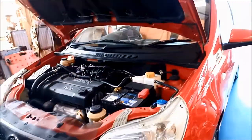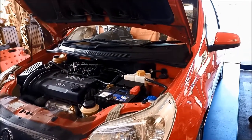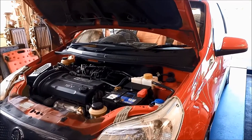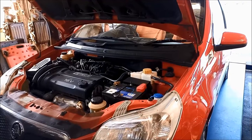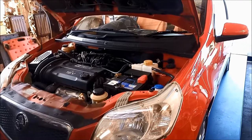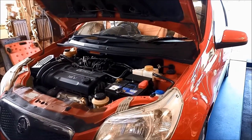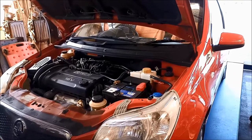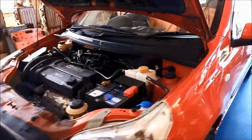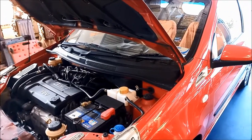What's happening is there's a funny noise - it sounds like it's on the left hand side. If I drive along under load there's a noise, and if I coast in neutral the noise is still there. So by doing that test, sometimes if it's under load it's usually like a CV joint or something like that. If it's constantly there, even when you put it into neutral and let it coast, and the noise is there, it usually indicates that it's like a bearing noise.